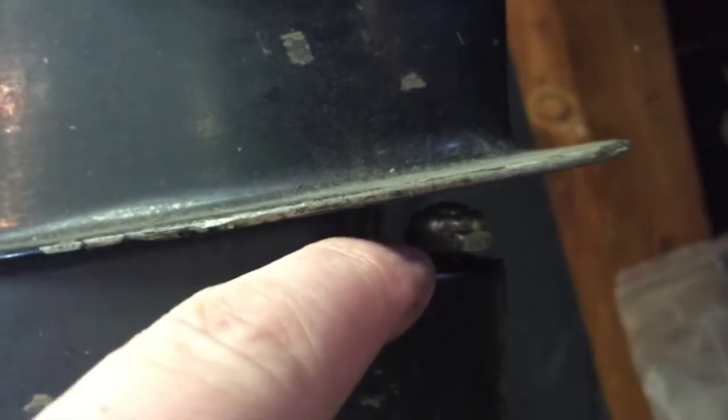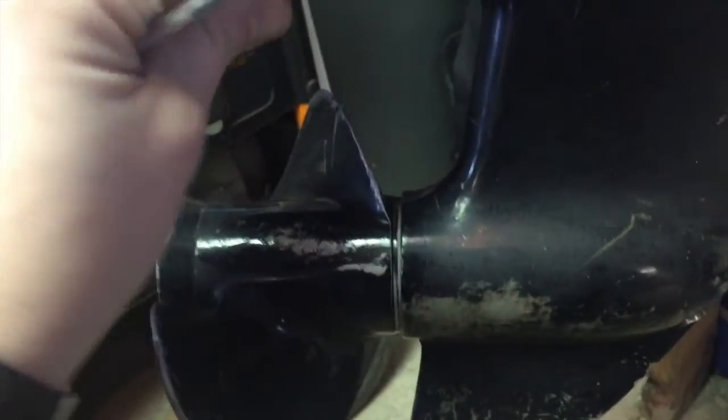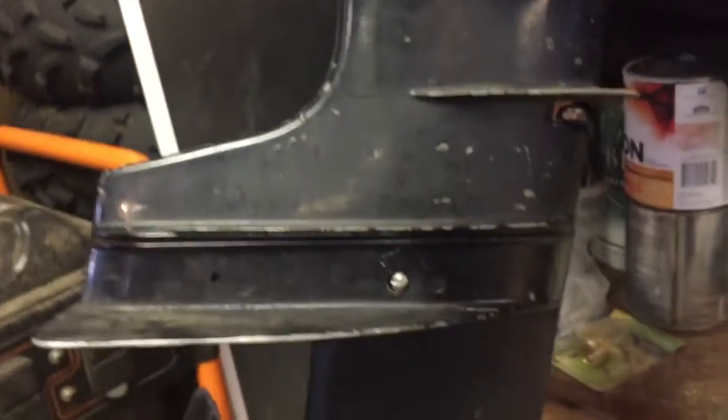That's a half-inch drive lock nut. The one up top here is a nine-sixteenths, or you can get away with using a fifteen millimeter. You'll have to loosen that one up at the same time and let the lower unit fall down a little bit. So we're going to pull this lower unit off and see what the impeller looks like.